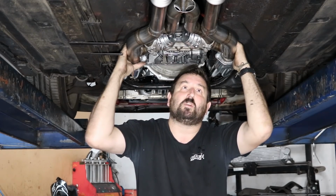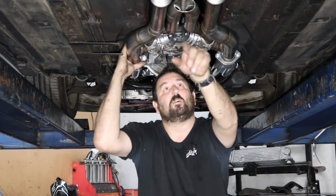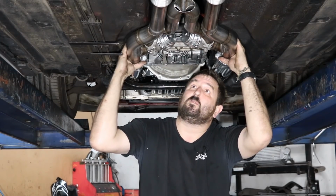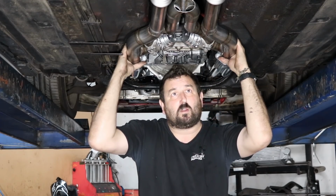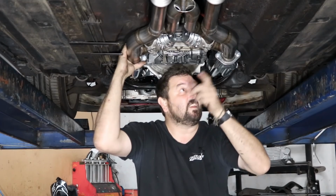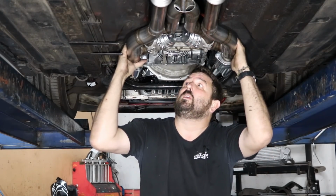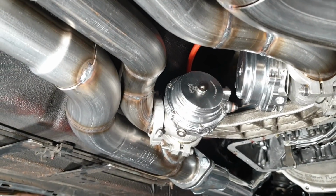It's mostly done. I've got to finish weld a few spots, finish weld the gate merge, put the screamer dog in. We've got to pull it all back apart and wrap it, clean all the insides out, because unlike normal exhausts, all of this has to flow through the turbo, so any crap that's in there is going to destroy wheels and whatnot.